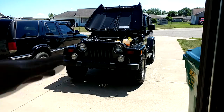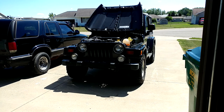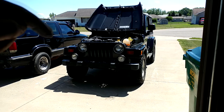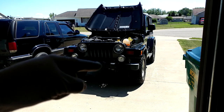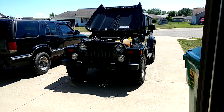I got the thing home - it seems to be stopping okay, like it's completely safe to drive, but I don't think the brakes are where they should be yet. It looks like that coating on the rotors is just going to take forever to wear off - you can still see the crosshatch pattern. I think those pads may be significantly harder than I'm used to, so maybe that's just it. I did pressure bleed the brakes again just to double check, because when I got home I noticed the left front wheel was significantly warmer than the right front. They both had just tiny little amounts of air in them. It also dawned on me that the driver sits on the left side and the Jeep's only got a 96-inch wheelbase, so that's probably why the left front brake works a little bit harder.